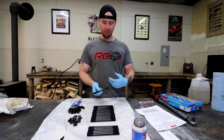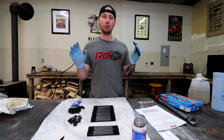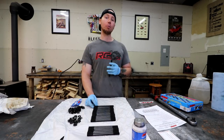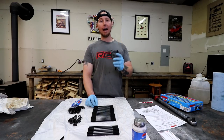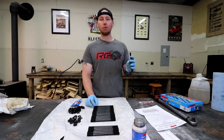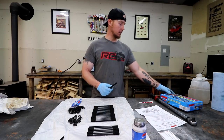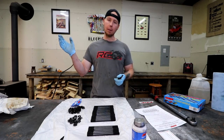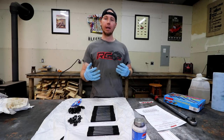That reliability comes at a price. These are made out of some kind of crazy material — it's like $450 for 28 studs. I have no idea why they cost that much. When you look up anybody who builds a performance engine, especially a boosted one, everybody uses a high-grade head stud and there are no cheap ones — they're all very expensive. Hopefully this kit does what we want and lets us turn the boost up a little bit.